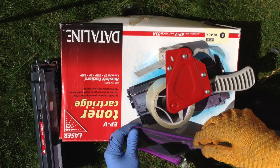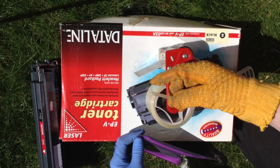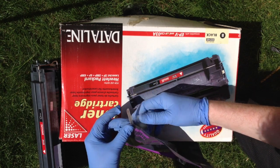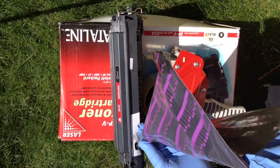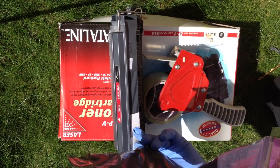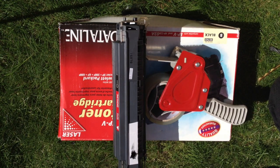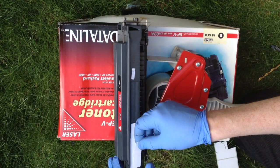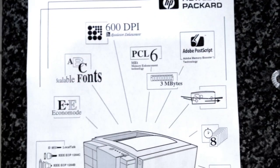What I'm going to do now is put a small hole in the corner of the bag and insert a piece of plastic tube, then tape around it to make sure it's secure, and hopefully fill it up. I'm doing this in small sections and then checking to see how full it is — I can actually see all the toner going in. Now I need to put the label back on, stick it over the hole, make sure it's well stuck, and then put it back into the printer. That's the hole fully blocked. I'll clean up the cartridge, give it a shake, and then run some test prints.